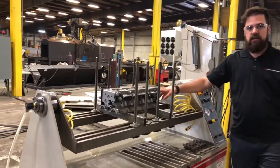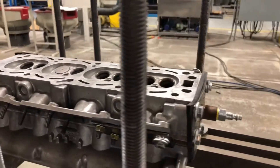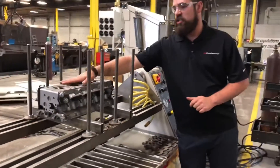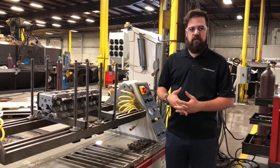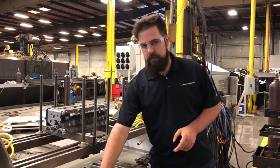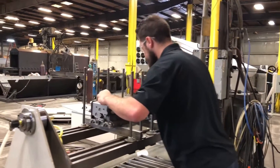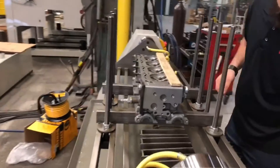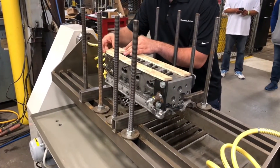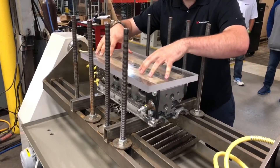There's an inlet and an outlet on either side of the head. The goal during pressure testing is to seal up all the openings in the head's water jacket. Up on top where the valves are, there are quite a few openings — that's why I have these gum rubbers cut. We'll seal it up with that, and then use the acrylic plate to cinch those down.